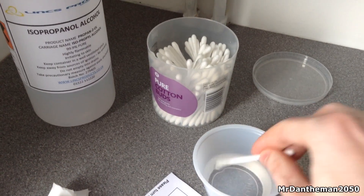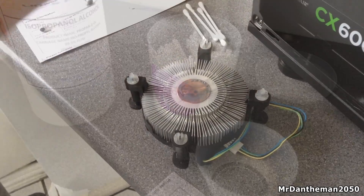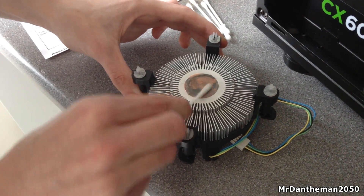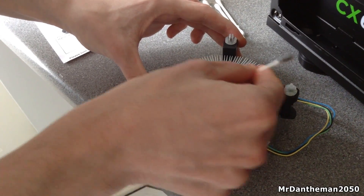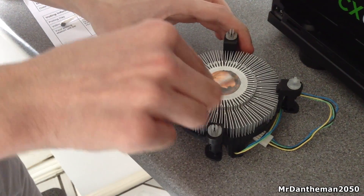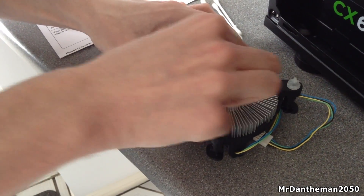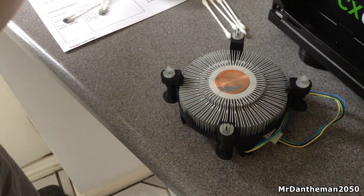You want to get your cotton swab first and practice removing the thermal paste from your old cooler. Because you are going to be removing thermal paste from your CPU, if you have a little bit of practice first you should be able to remove it easier. The alcohol just helps loosen the thermal paste so it sticks onto the cotton swabs. Some of it will be a little bit more difficult to get off — there will be some dry parts. That's typically where your CPU runs hotter, so just go at it with cotton wool. Just remove the thermal paste.